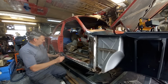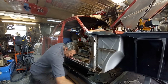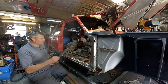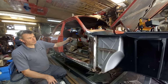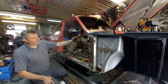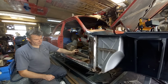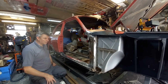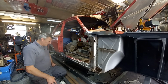The good thing about keeping these on this side is I can pop the door back on and off. What I didn't show you is how I got the door hinges out, and these can be a real swine on these. It wasn't too bad on this side, so when I do the other side I'll film that, but this is my tool for doing that. It's a little bit of box section with a bit of 8mm bolt welded to the end of it. Put them in there, hit that with a hammer and tap them out. Simple as that. And they're hit and miss. Sometimes they come out easy, sometimes they're a real pain in the neck. Right, okay.